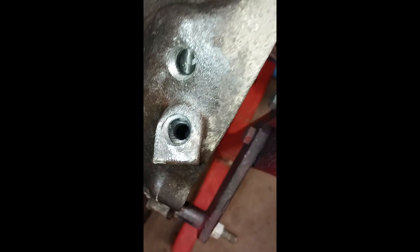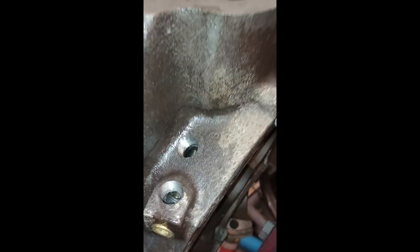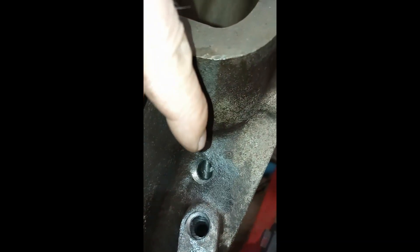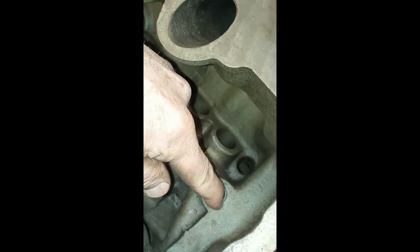The way it has to work is the oil comes up this hole, goes out to the filter, then comes back and goes into the system through that hole. I'm actually going to weld that up — some people don't think you have to plug it, but I'm going to weld it so it can't leak.